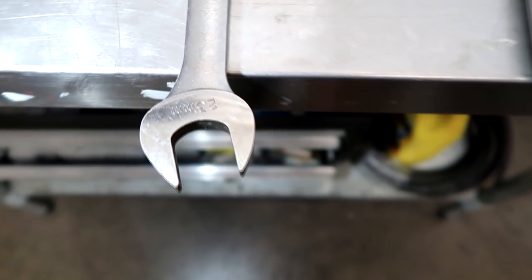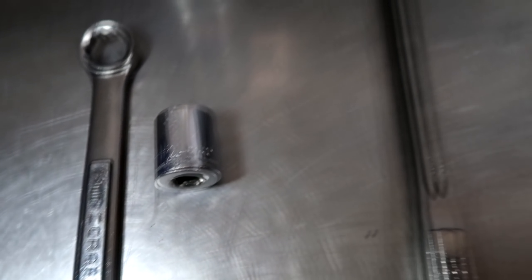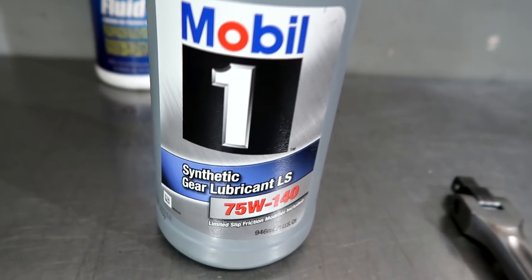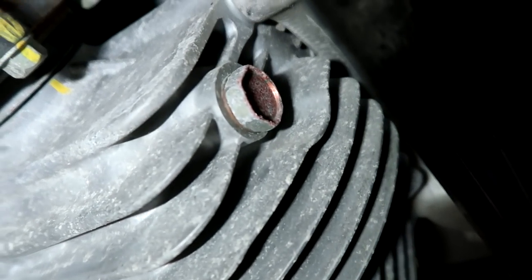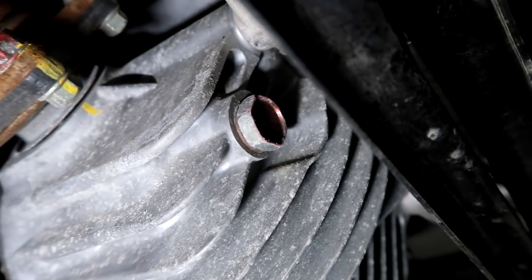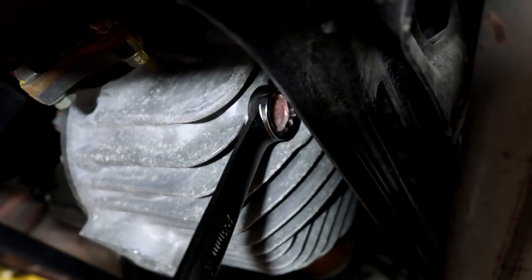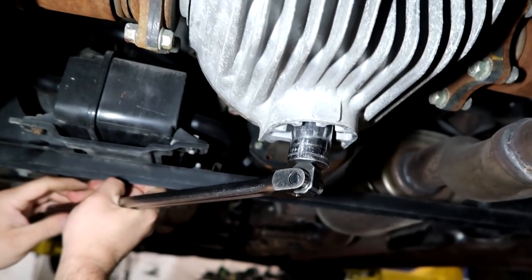The tools you're going to need for this: 23mm wrench, preferably a closed end, 24mm socket, and a breaker bar that fits your socket. Your Mobil One 75-140. Just as before, there is a fill and a drain. Make sure you have those tools before you break these loose. I've seen people use crescent wrenches and vice grips to get this one loose — it is a pain. It's a 23mm. This one is worse — you can only use a socket. Make sure you can break the fill first. If you can't break that loose and you drain the fluid, you can't put fluid back in.